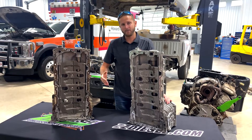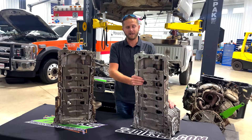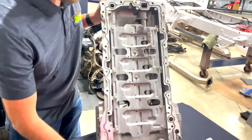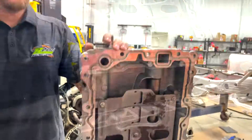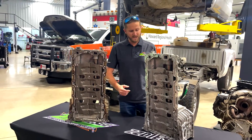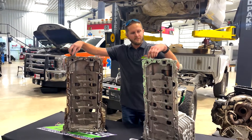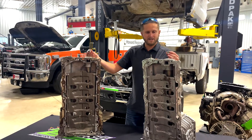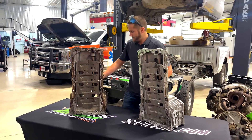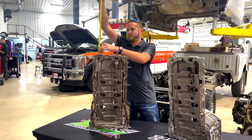Now I'm going to show you what happened and where we ran into a major engine failure with a brand new oil pan provided by Ford. These plugs, as you see right here, are installed into both ends of the oil pan. They're pre-torqued from the factory. As a technician — even a master Ford tech — you're not supposed to take this apart; you'd assume it's ready to go and has been through quality inspection. I'm going to remove both of these plugs. I have them loosened up because they're very hard to get out — they take a three-quarter inch Allen and are torqued very heavily.